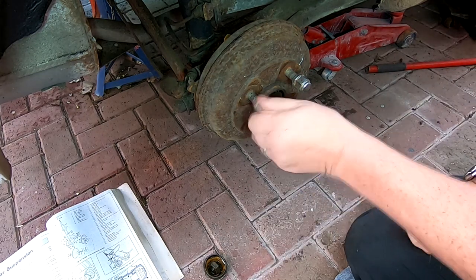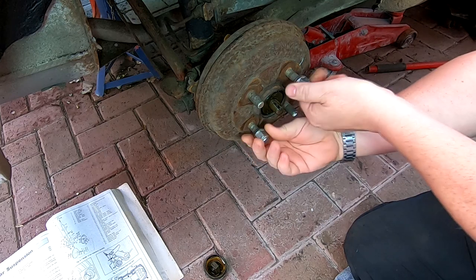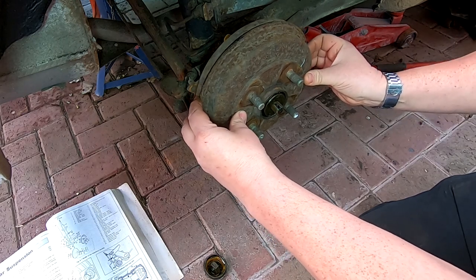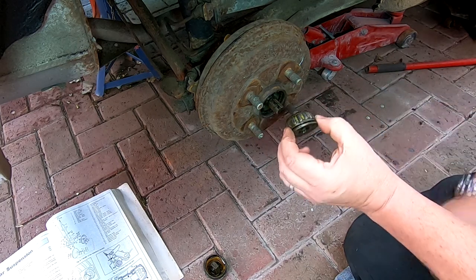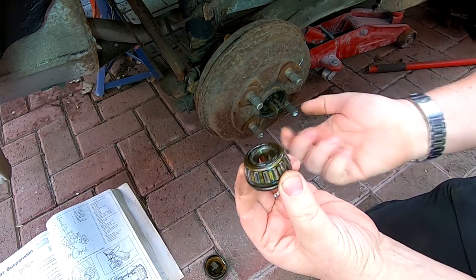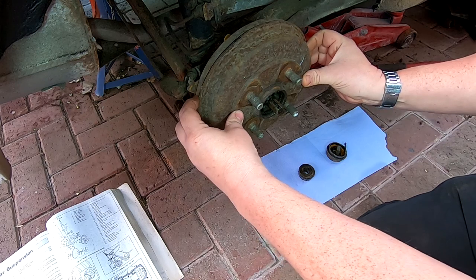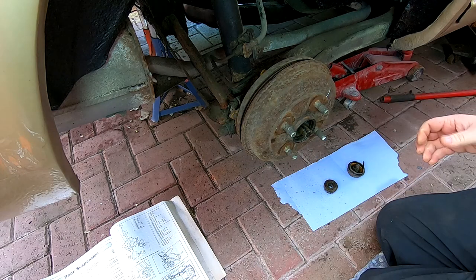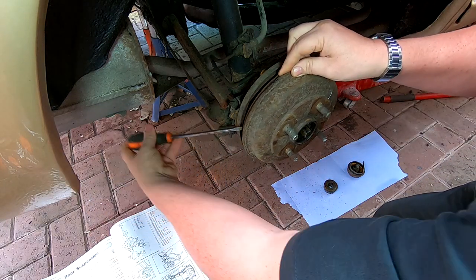That's the nut off. Now, I think I've got to take the lug nuts off because I think these are maybe on the back — oh no, they do come off with the hub by the looks of it. I'll take them off anyway. Now hopefully this should draw off. As you can see, the bearing is nice and loose, so I want to take that off carefully. There's our tapered seat bearing there, as you can probably see. And that wants to remain clean because we adjust it by the tightness of that nut. So that's how simply they're adjusted. Just by withdrawing this, should be able to take the hub off. Sometimes the pads can get caught on the edge of the drum and that can cause them to stay on — just gently ease it past the edge of the drum.